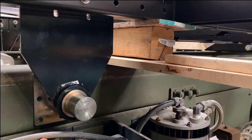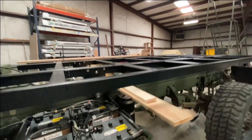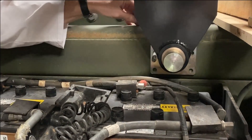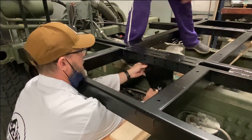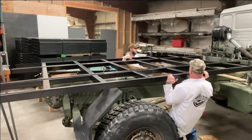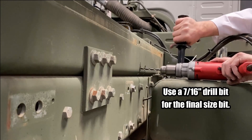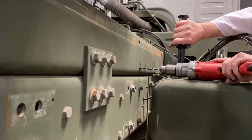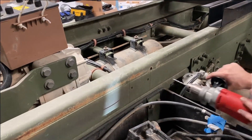Use shoring material as necessary to center the side brackets on the upper frame. If mounting to a vehicle such as a Ford, Chevy, Dodge, Unimog, etc., the subframe will need to be leveled with the truck's frame. Now that the brackets are located, it is time to mark and drill the holes in the truck frame. The best way is to use a center punch correctly sized to the holes in the mounting brackets. For added precision, mark any two holes onto the frame from each bracket, then remove the bracket and move the subframe a few feet toward the rear to drill. Start with a smaller drill bit and step up sizes until the desired hole size is reached. Use a cup of oil and a small utility brush to lubricate the drill bit to prevent overheating. Depending on bracket placement, you may need to remove the battery for ease of access.